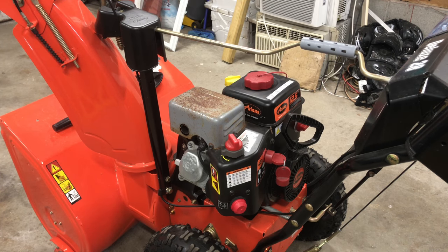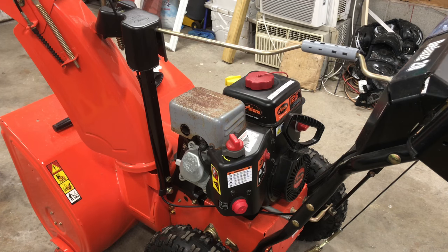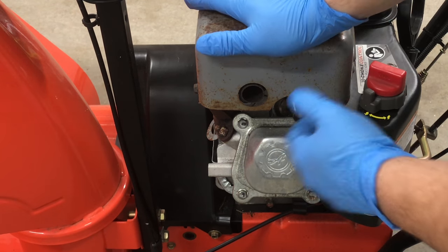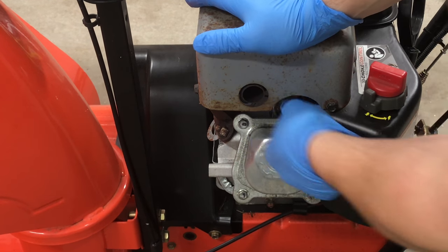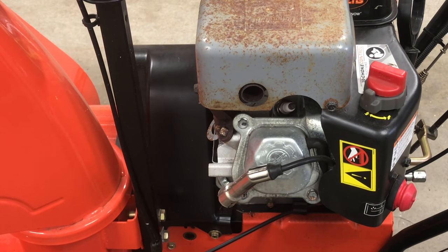Okay, so before we begin, a couple of things you should do. Whenever you're working near the motor, you don't want to get hurt — you don't want it to accidentally fire up. So make sure you take your key, turn the machine off, and remove your key. You should also — and this is like another added safety measure — pull the boot off the spark plug. That way the engine can't get spark if you accidentally rotate the auger. This happens to be an Ariens. If you have an old Craftsman or something, it's pretty easy to get at these boots. So take the boot off the spark plug, let it dangle there, and now we should be pretty safe to work up in front of that auger.